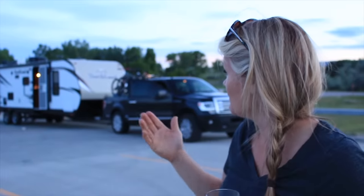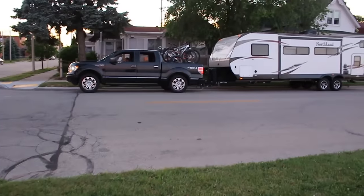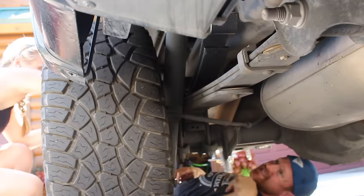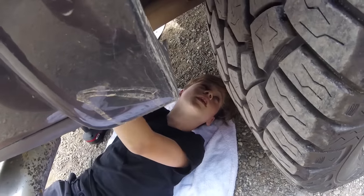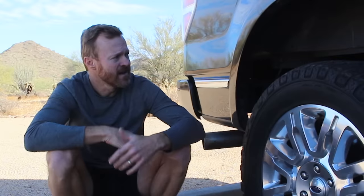I had a sagging problem going through Montana and Wisconsin and I just got tired of seeing the truck sagging in the back. A lot of people have had success with Helper Springs. I put them on when we got to Michigan and rode them all the way to Belfast, Maine, and that's where I took them off. They basically did not make that big of an impact — they only prevented the sag by about one inch, and they made all sorts of noise when I hit bumps. So I took those off in Maine within the 30-day Amazon return window, returned them, and got the Firestone RideRite.